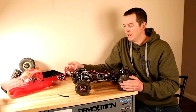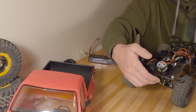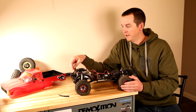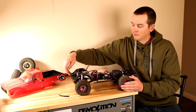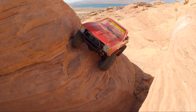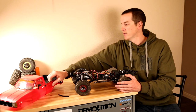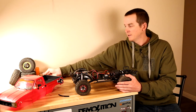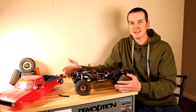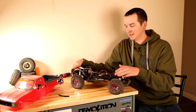My final upgrade: I took the RC Four-Wheel Drive bumper, cut it up, used the bull bar and the bottom mount since it was already welded and drilled-and-tapped for mounting back into the front cross member, then bent up my own solid rod to form to the front of the truck with a couple of little supports. I had help from a friend who runs Low Range RC — if you haven't heard of them, they make little tow ropes and big stinger bumpers, some with the option of a bottle opener right on the stinger, which is a really cool design. Shout out to Low Range RC — I'm excited to see their future products.